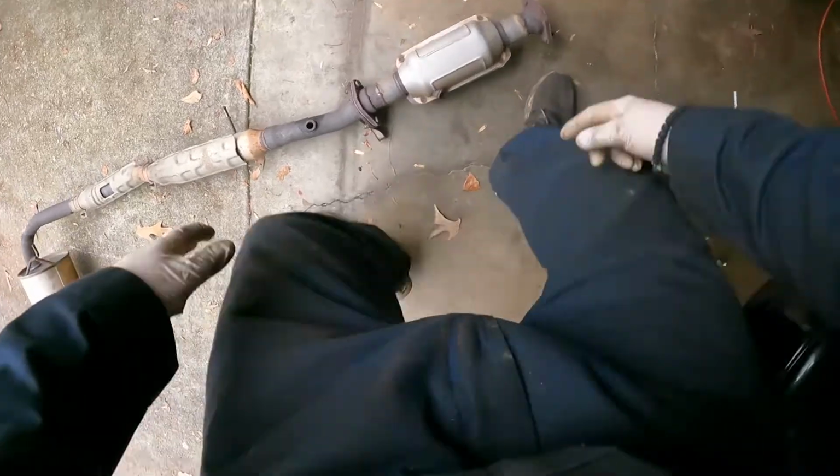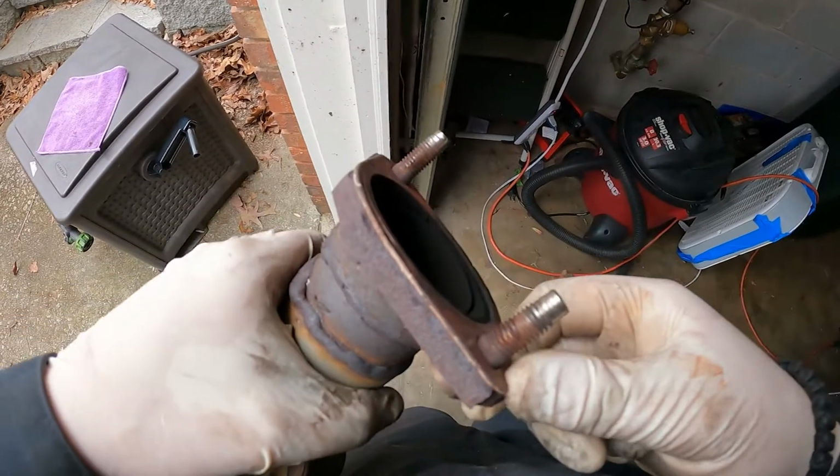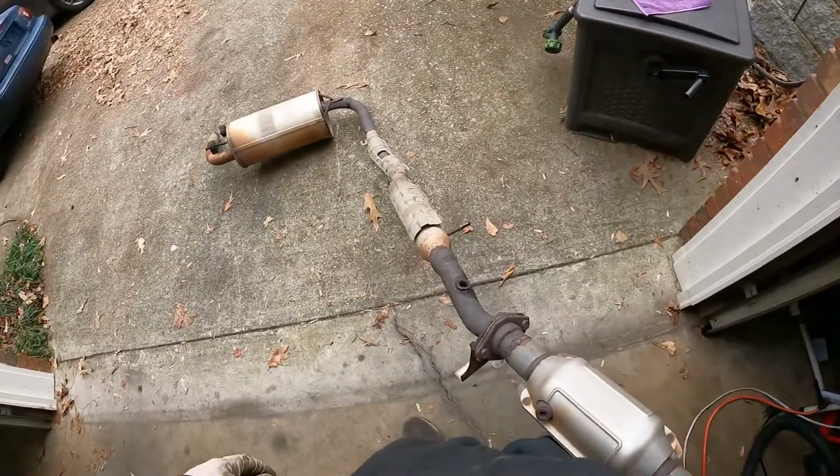A few moments later. Alright, remove the exhaust. The two nuts definitely cause some havoc, so a tap and die set is really advantageous. We'll clean those threads up on reassembly. So next step, once you remove the exhaust, is get back under the car, remove the drive shaft, and the wiring.